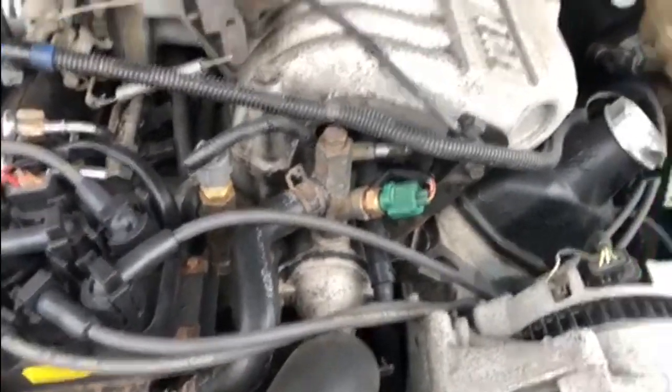I can't get the ABS light to go off and can't work out what it is. Normally you'd just plug in an OBD or OBD2 reader — the socket for the OBD2 reader is under the dash. But if you plug an OBD2 reader in there, it doesn't recognise that there's anything wrong with the car as far as the ABS system is concerned. The main reason is that the ABS test socket is not actually inside the car — it's under the bonnet, between the battery and the fuse box.